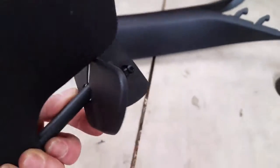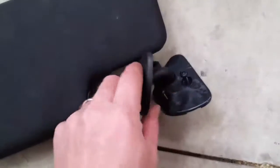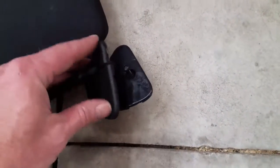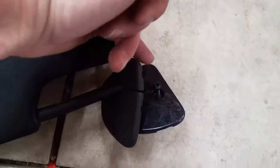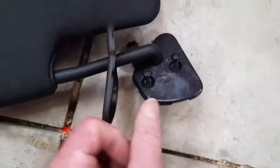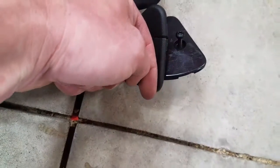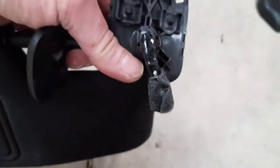The visor mechanism is really simple. It looks difficult to remove but it's not. It's a thin plastic cover that hides two screws. You get your putty knife, lay on your back, go on that joint and then push outwards — because all around the perimeter there are little teeth that want to lock in underneath. So use a little putty knife, press outwards, work your way around, keep your finger under there. Eventually when you get around about halfway, it just pops off. Then you get the screws, it comes right out — unplug the plug. Fantastic.